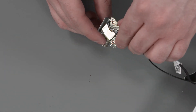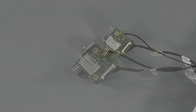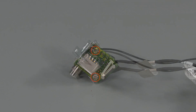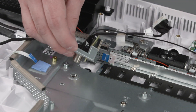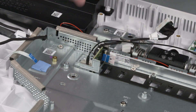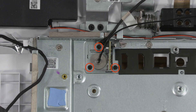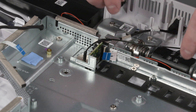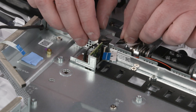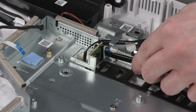Replacement: Slide the SIM board into position on the F-connector bracket. Replace the two P1 Phillips-head screws that secure the SIM board to the F-connector bracket. Insert the F-connector into the cutout in the display cover. Replace the three P1 Phillips-head screws that secure the F-connector bracket to the motherboard shielding. Route the F-connector antenna and remote control cables through the routing channel on the motherboard shielding. Insert the SIM board ribbon cable into the ZIF connector on the SIM board and press the locking bar down to lock the cable into place.